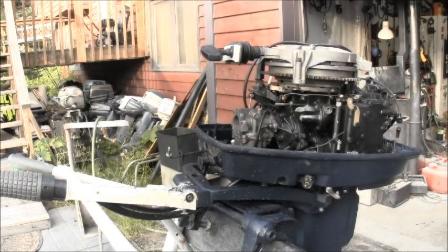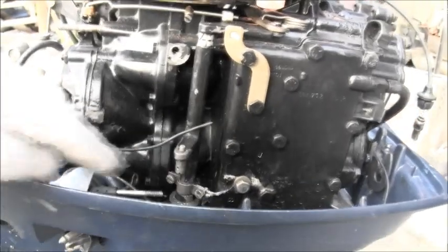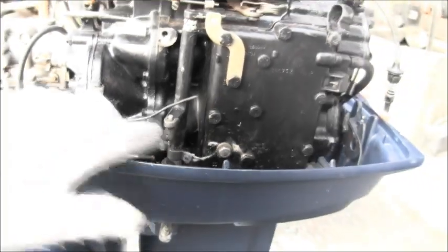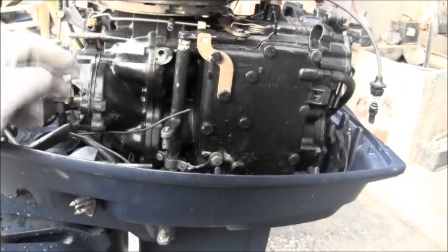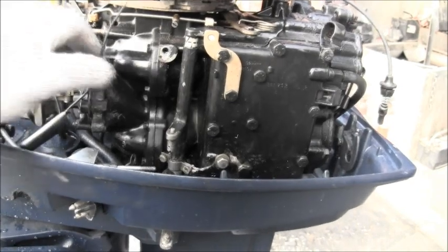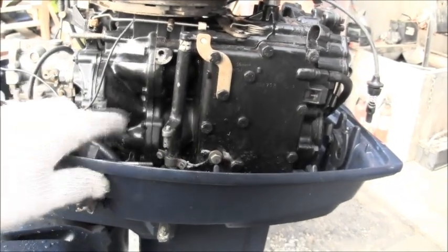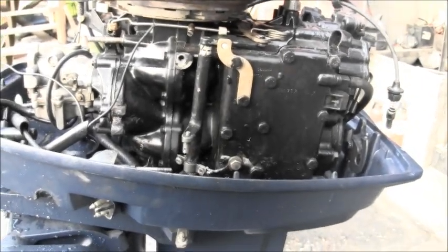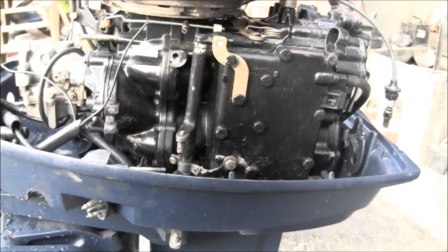So we've got that, and if you look right in there, right here, you can see the cable, and that's nice and loosey-goosey, and it will go right here, and then the little keepers will be on the starter bracket that hold this. I know it doesn't look like it would fit, this is my kill wires and so forth, that whole starter bracket. You would think this is going to be in the way, but it will fit. The way they've got the solenoid mounted coming in from this way, you'll see it all, but it does fit. I've done it a number of times, and it will fit in there. Barely, but it will fit.